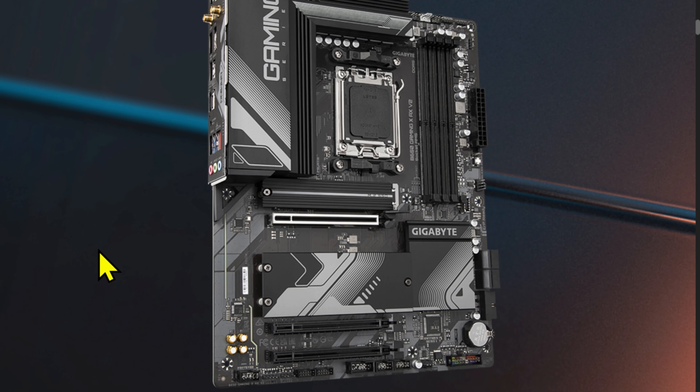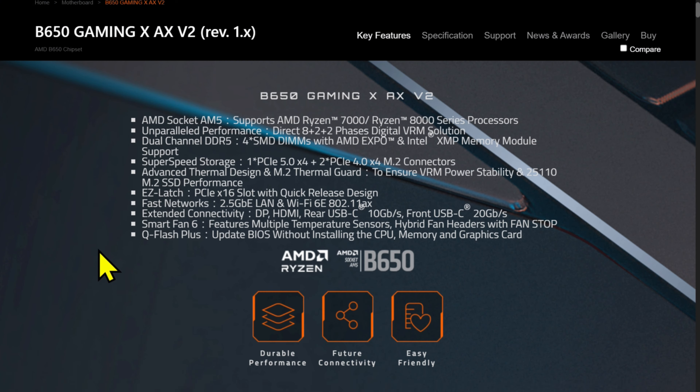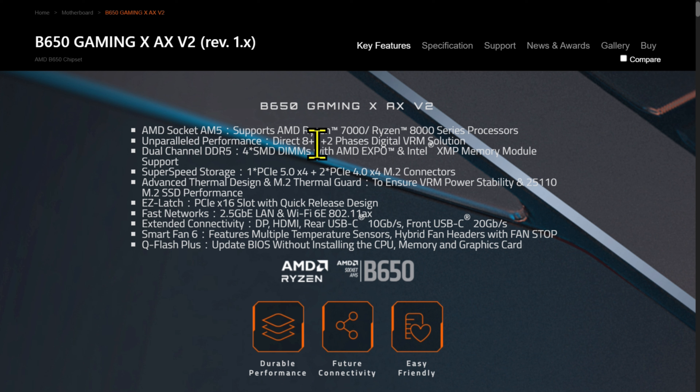It's probably fine if you don't plan on putting 32 cores in it when the Zen 6 chips come out — that's probably going to want a new motherboard. This is definitely what you call a budget motherboard, and my biggest gripe is the power delivery. It's really an eight-phase power delivery, versus 16. You don't need 16, 14, or 12, but CPUs are more demanding and they can require burst power. The whole point of a really good power delivery solution is that the onboard power delivers highly stable power under highly variable loads.